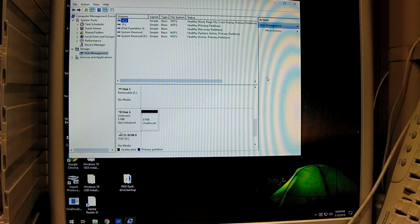I already mentioned what happens, but I'll mention it again if it wasn't clear. The firmware on this drive, after a certain power down cycle, when your system is shut off, fails at random. The next time you turn the computer on, the drive does not initialize properly.